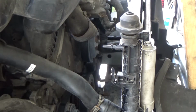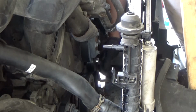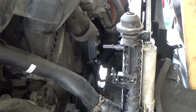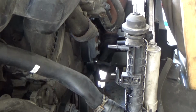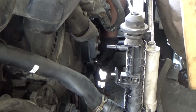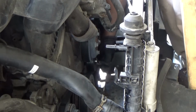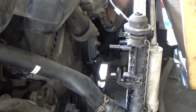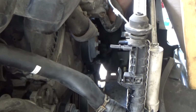Today I will start with the alternator, and the first thing to do is just to remove the hose, the belt. So you take the 15 millimeter wrench and pull it up counterclockwise, slide it off of the pulley from the tensioner.